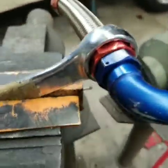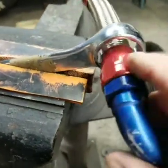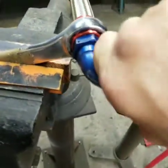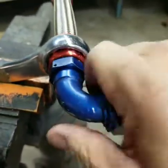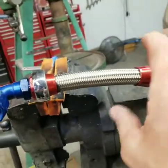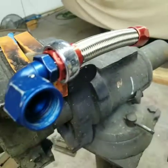When it's all done, you typically leave a little gap between both pieces. I like to have the flat even with the other flat. The nice thing about these is you can adjust them — they're floating. I don't think the Fragola ones are floating; these are actually more expensive but I couldn't find them. I like to have a little bend in the line instead of going straight to straight — it gives a little shock absorption. This one goes on the tank, bends slightly up, then goes to the pump.